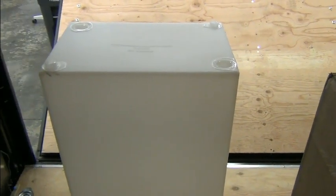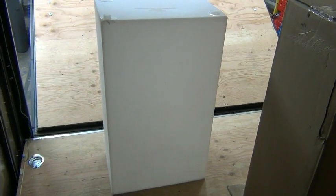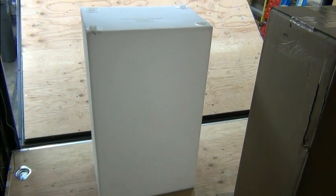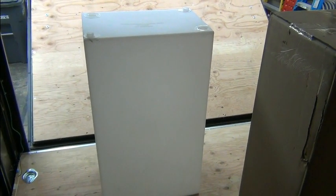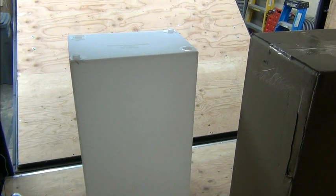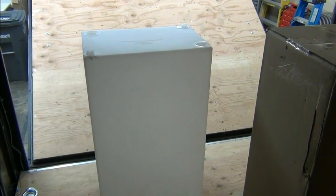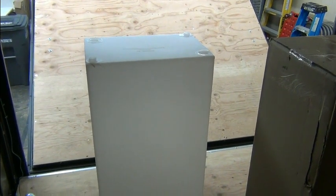Like I said, it's 50 gallons, and I don't, off the top of my head, know the exact dimensions, but it's a pretty good sized tank. But that's as large as I dared go, but I wanted to get as much water supply as possible, give us as much time, since all of our appliances, everything will be electric. And so the real limitation is going to be on our water. And so I've got 50 gallons of fresh, and I've got 46 of gray. Plus 4 gallons in the hot water heater. Our weak link will be the gray tanks at 46, and that's all I could get to fit between the frame rails, because they're going to go in the nose here underneath, not all the way forward, of course, but somewhere in that area.